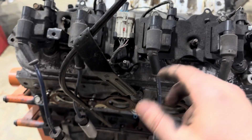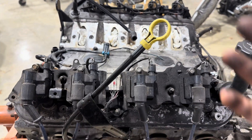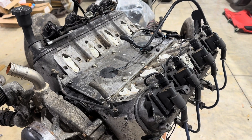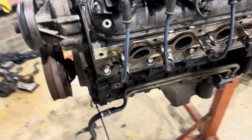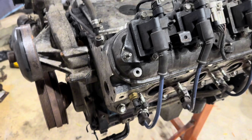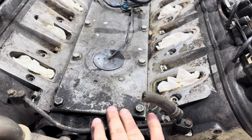One thing I did was put a little dot with a paint marker — you need to be mindful of which side your coil packs are on when you take them off. They're not directional but they have a side, so your driver side and passenger side have different plugs. If you hook them up backwards, whether using the factory harness and ECU or something aftermarket like a Holley, that is going to give you grief. So I'm going to degrease all this and scrub it down.